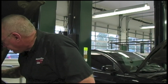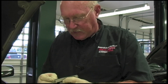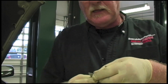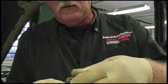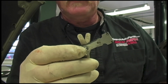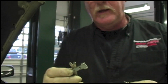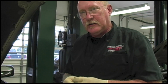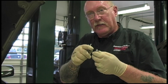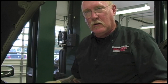Another type of gauge available is a flat feeler gauge — they come in a variety of sizes. There's also a tool for adjusting the ground electrode to set that gap. Stay away from the ramp wheels. Use either the feeler gauge or the round wire gauge to check the gap — that helps avoid damage to the precious metal on the tip of the center electrode. If you do happen to break that off, the plug's no good; throw it away and get another one.